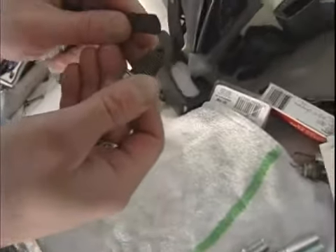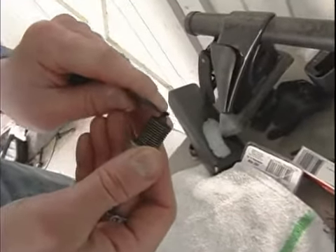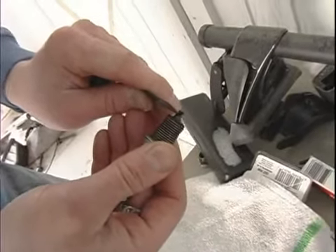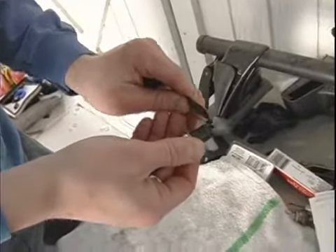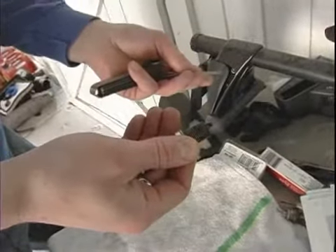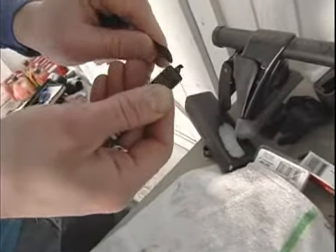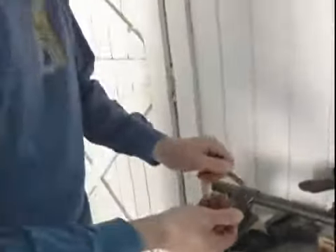Now right here, the gap right there — that's where the spark jumps in between these electrodes. If it's connected because there's so much deposit buildup, that means there are just too many deposits accumulating inside there, causing a bridged gap. That could result in a dead cylinder because if there's no gap it's not going to fire. So if it's misfiring, that could be one of the things.